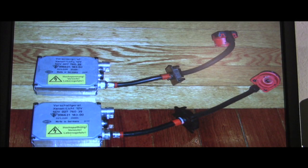The downside to a lot of this HID stuff is the onboard computer. If you have an onboard computer with check control function, if you run a wiring harness, if you run these types of ballasts, if you run a plug and play kit, there's a high probability you're going to get an OVC failure code.